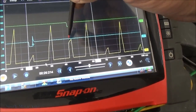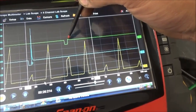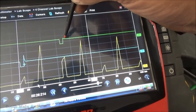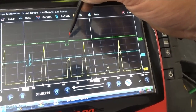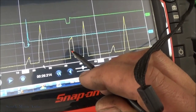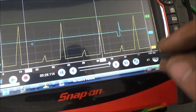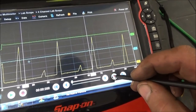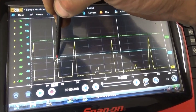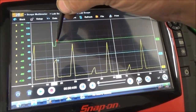But then we come over here and we can see our problem. So this is our number 6. We can see the control side works. It's running about battery voltage, gets pulled to ground. When the coil's released, there's no feedback voltage, so it just goes back to battery voltage. But on our current ramp, look how high amperage that's drawing. Just have to stop this for a second and see if we can get it in the screen. So that's at almost 3 amps. That injector is definitely shorted, and it's also reflected right there in the control side too.